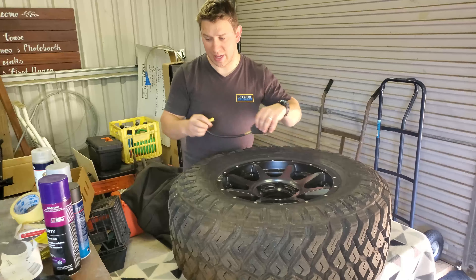You'll also need a little bit of black spray paint — the design I'm doing means the inside stays black, and I'll use that to dress up the center. I've also got some semi-gloss clear coat, using the Duralux brand because it tends to dry pretty quickly. You're going to need at least probably one can per rim. You want a nice thick coat of clear coat on top to protect the paint — rims get blasted with sand, mud, and water, so give lots of coats.